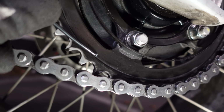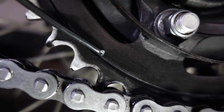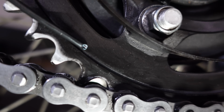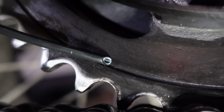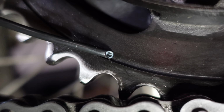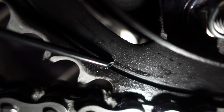So all that's left for me to do is to push it and the little steel bracket here just bends into place. Push it so there's a tiny bit of tension, preferably into this little step here. And also, very important, I've got the nozzle so that the point is touching the sprocket and that angled cut is actually facing away.